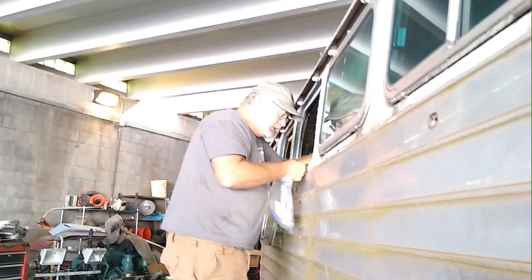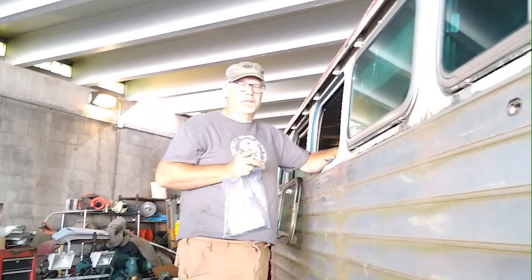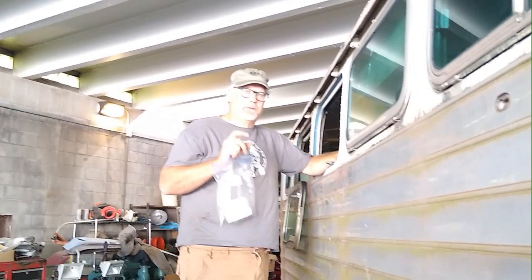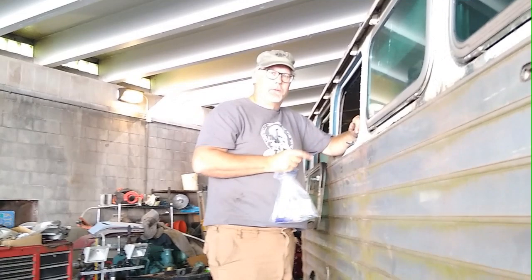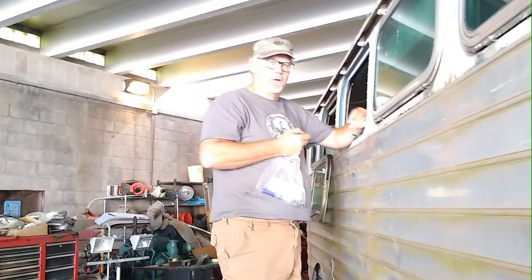It's not the coil opening up. It's people twisting the connections off. Actually, the problem that I've been told is that the coils burn up because they're not adjusted properly, so they don't open all the way, and the coil stays on, and it eventually burns up. So those two coils in the back of the reverse solenoid are what causes those to fail, and they're hard to find. Oh, okay. Well, that's good to know. Okay, that'll do it for now.